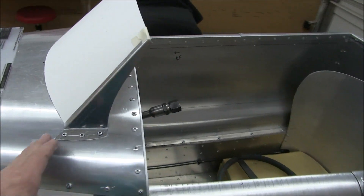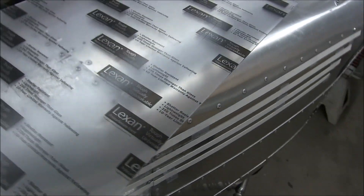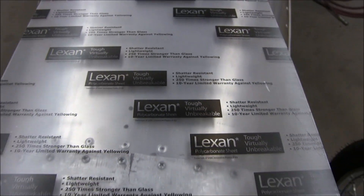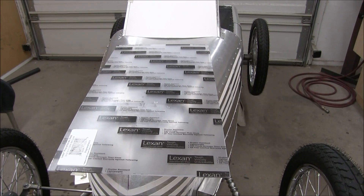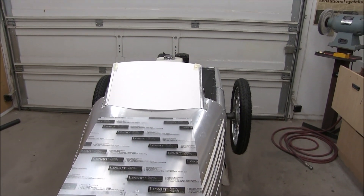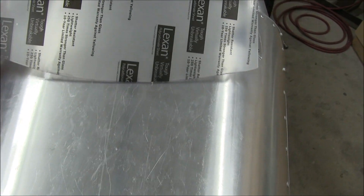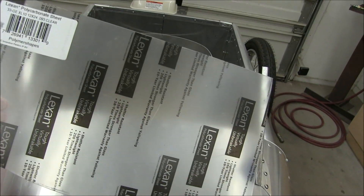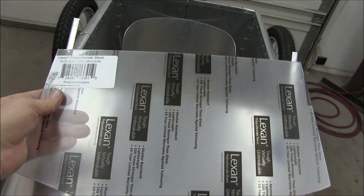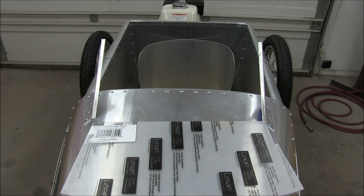I have both brackets installed now and I've made my pattern. I have a piece of eighth-inch Lexan plexiglass — got it over at Home Depot, I've used this on the BMW and the Monicar. It shouldn't be too tough to cut this. I've cut the plexiglass to shape but it's under quite a bit of tension when I put it between the brackets — it really needs to be curved a little bit, and I have an idea of how I'm going to try to do that.